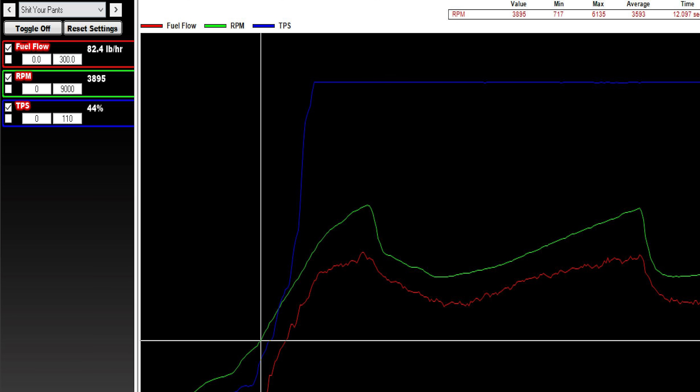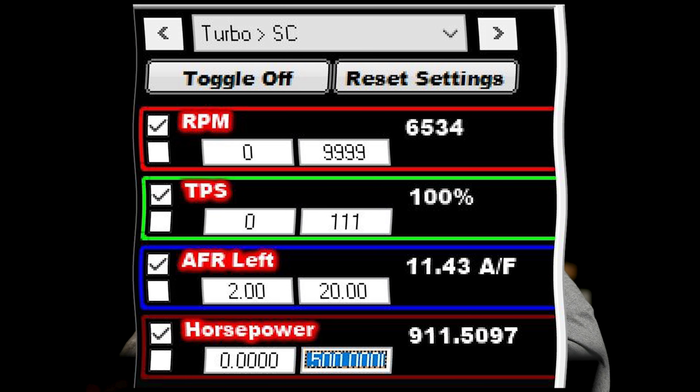The goal is to get all of the injector data correct. Holley is not nearly as picky about this as some OEM ECUs — if you have data that's at least in the ballpark, your VE numbers might be a little off and your fuel flow calculations a little off. If you're trying to calculate horsepower based on fuel consumption, you'll get inaccurate numbers. But if you have something close, you can usually work with it. However, if you're expecting closed loop and learn to save you in these situations, it's going to leave you pretty disappointed and will require manual tuning.